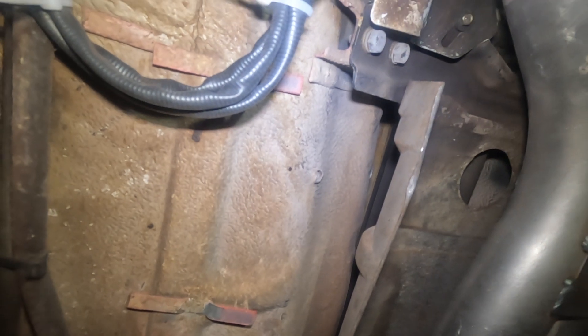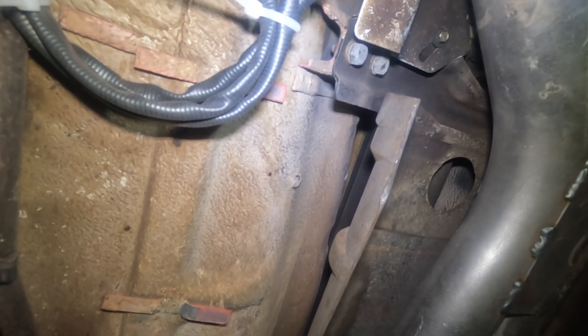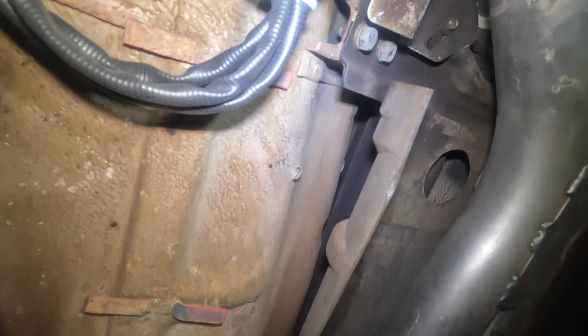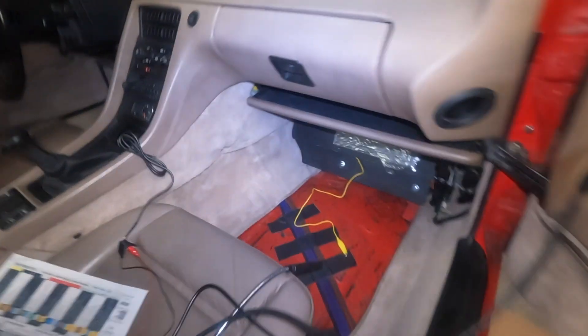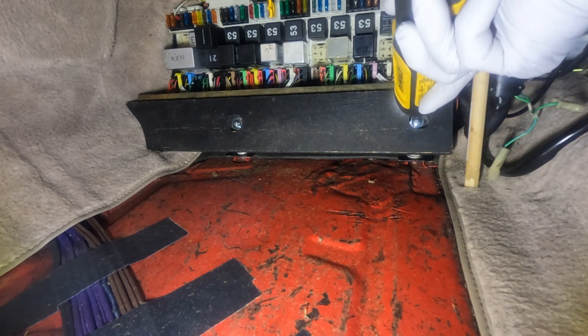The line that went inside just got snipped. I don't know what they were doing or whether it got connected to anything, because I don't think the ECU — the brains of this vehicle, the LH ECU — has a port or reads the O2 sensor. There's nothing to plug it into, at least I can't find it. So basically I'm going to read it and go from there.